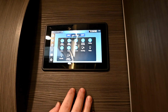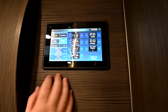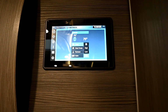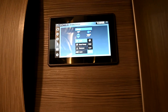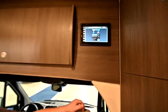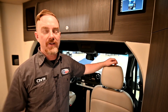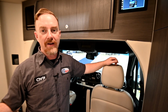Below is your sea level monitor. This will give you your battery monitoring. It is 13.3 volts. Also, the status of your water tank. So the fresh tank is 25% full. The gray tank is 4% full, and the black waste tank is 19% full. The signal from here is repeated over here onto the Firefly. But if the Firefly isn't functioning, you can still look here, as this is where the signal originates.